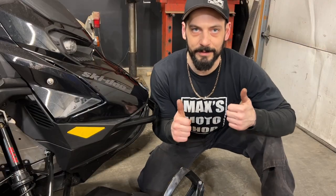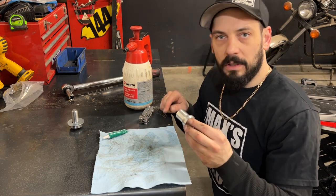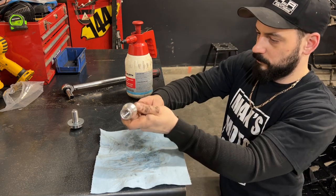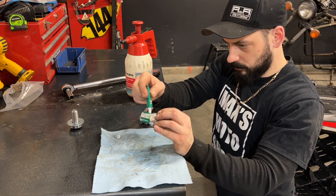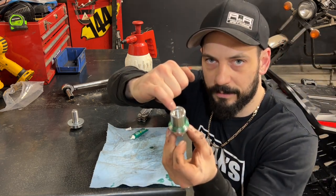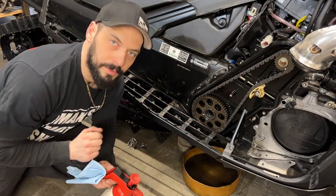If you're finding this useful, smash that thumbs up and check out those affiliate links in the description below. Before I install the retainer, I'm going to clean it off with brake clean and give it a heavy coat of sleeve retainer. I'll let it set up for about a minute or two and then I'll slide it into place. We got a nice thick layer on it. Do not get any sleeve retainer inside your threads or you'll never get the bolt out. I'm going to take some brake clean and clean out the inside of the shaft where the retainer is going to sit.